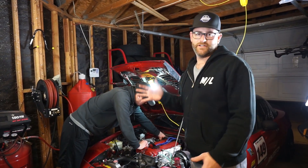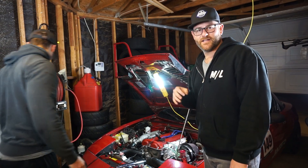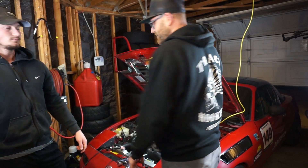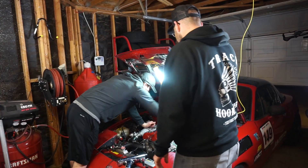So we set it to 14, which is good on the NA 1.6s, just to give us a little bit of extra. Beyond that, all we gotta do now is tighten down the 12 mil on the distributor. Ryan's gonna do it right now.